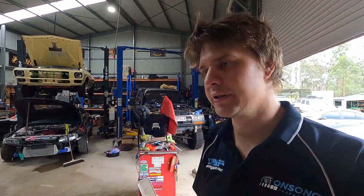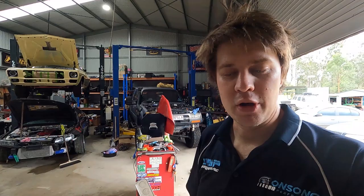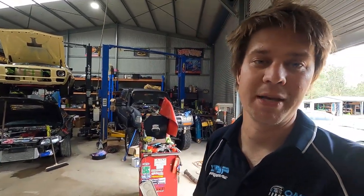And while we're waiting for those, I'll probably start getting our exhaust housing for the turbo ready. So one of the sensors that we will be adding to the car is an exhaust gas pressure sensor, or EMAP, exhaust manifold absolute pressure, which I'll show you how we're going to do. You've got to be very careful with it, obviously, because the exhaust gases are one, dirty, which means sensors don't particularly like that, and two, obviously very hot. So you've got to do something to combat both of those issues, and I'll show you as that goes in the car. But it means that we want to put a 1/8 NPT port in the housing.